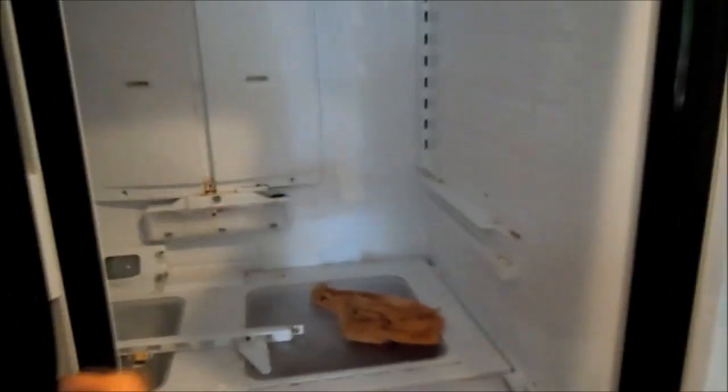We've got a bunch of ice out. I've been here at least an hour working on this thing. Tried to clean the defrost drain through the bottom — it's frozen up inside there. Had a wire, tried to run through there, it didn't work. It's still pretty cold; I can actually feel a big chunk of ice right under here. It's almost there but not quite, and I'm not going to reef on it. We've got time, so we're just going to let it sit and do its thing.